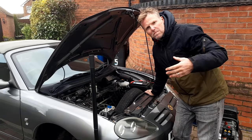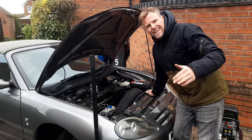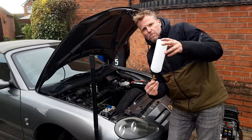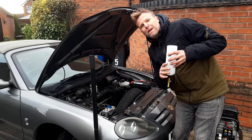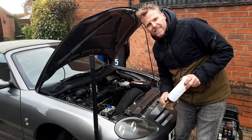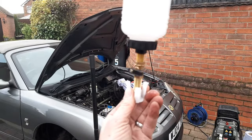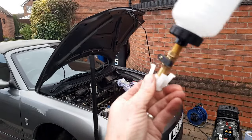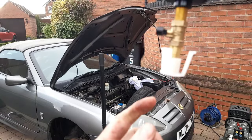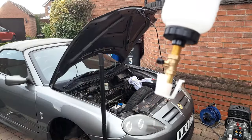Now we've fitted the new brake lines — quickly going to bleed the brakes. You also have this replenishment reservoir that sits in here, and as the fluid gets pulled through it replenishes it to make sure you don't run dry. It comes with these little white caps — these fit inside your reservoir, and you change the height by screwing it in until the brass bit sits just into the fluid. When the fluid loses contact with the brass bit, more flows through, and when the fluid comes back up, it stops. I've got my replenishment bottle in here, topped up near the line, and this valve's open — so this should come down as the fluid gets pulled out.